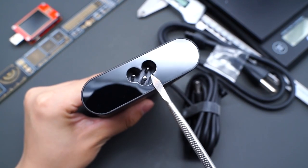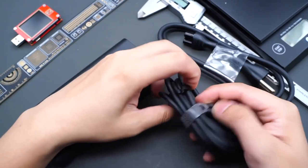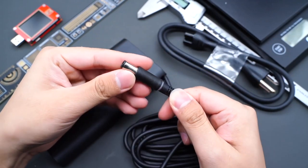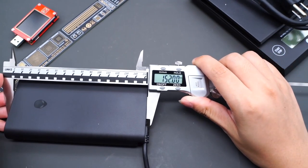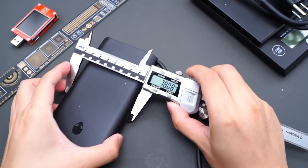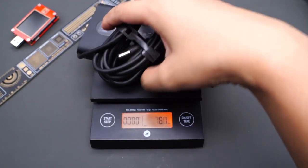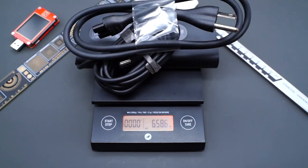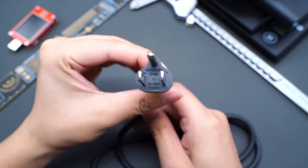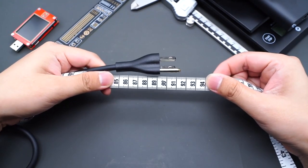Just replace the AC power cord. There is a three-prong interface on the top of the voltage converter, and the DC power cord is fixed in the groove on the other side. The DC connector has an LED light ring, and its length is about 176cm. The converter dimensions are 152mm length, 78mm width, and 23mm thickness. The weight of the converter and DC cord is 577g, and the total weight is 658g. The plug adopts US standards with a three-prong port, and the AC power cord length is 91cm.